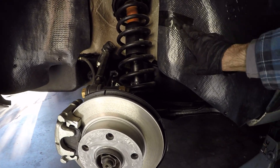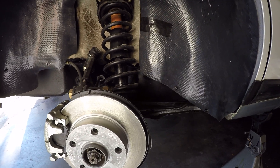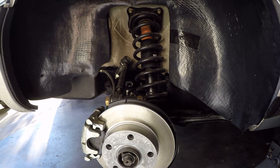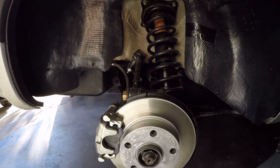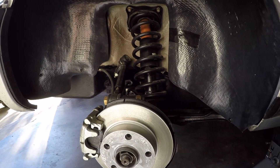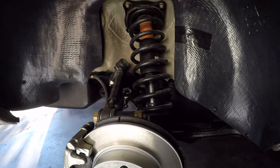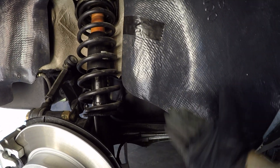I did have to put a little bit of Gorilla Tape on them because they cracked in shipping, but I didn't want to battle with the seller trying to get new ones sent since it took a month for these things to arrive. This now gives the rear wheel well a completed look — before you could see body color through the wheel well, which is usually an indication that something's missing. Luckily I still had all the mounting bolts. There are only four mounting points that hold these things in, so it's actually pretty simple to install. They did not come pre-drilled, but fortunately the holes are at the bottom where you can see and line up and drill accordingly.